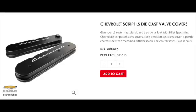Today's project is adding an oil catch can system to the Bel Air. We're in the middle of installing an aluminum block 6.2 LS with a Holley low-ram intake. I picked up some Billet Specialties script Chevrolet valve covers — they look really great, but they don't have any fittings for crankcase pressure relief. Billet Specialties confirmed people just drill into the valve covers and tap them for quarter NPT, throw on some fittings, and send everything to the catch can and back into the valley cover.